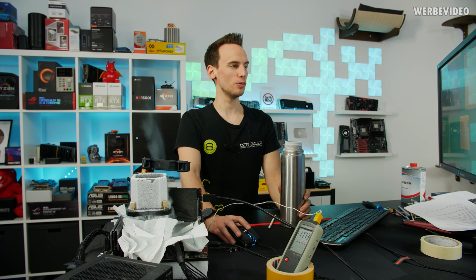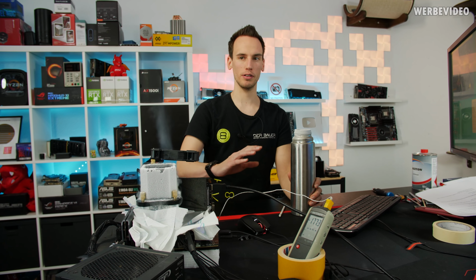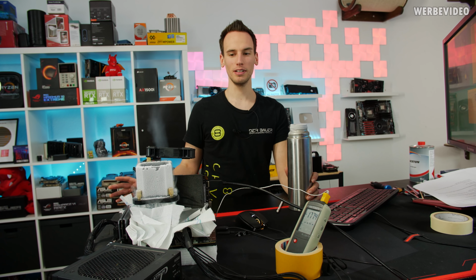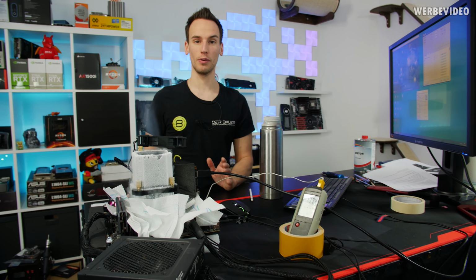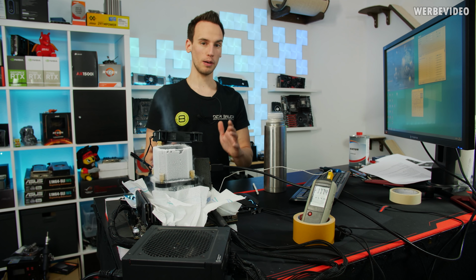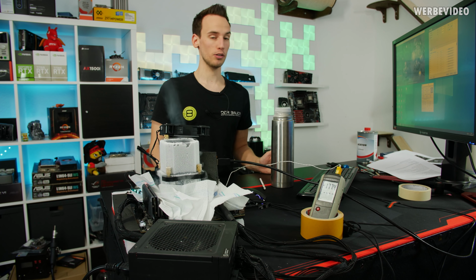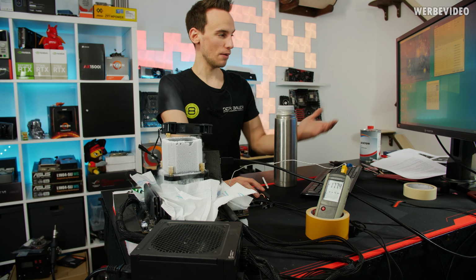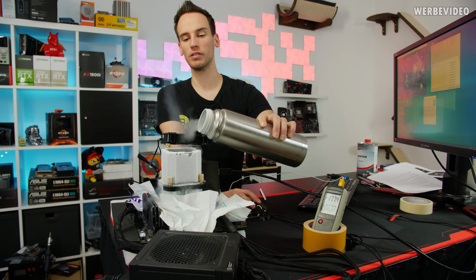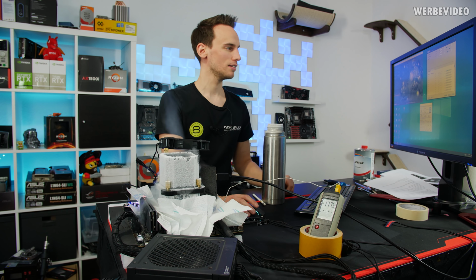You know what? It's just so absolutely amazing how easy extreme overclocking has become over the last, I would say, 5 to 6 years. If you compare it with like 10 to 15 years ago, it's a completely different story nowadays. I mean, the only thing I really did was cooling down, applying 1.45 VCCIO, 1.75 PLL termination voltage, flip the switches, cool down, full pot. I'm already running 6 GHz, 1.7 volts. Obviously, the CPU will be able to clock higher, but it's a piece of cake, really.